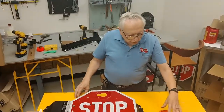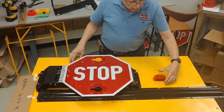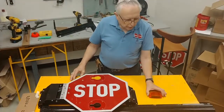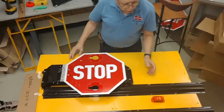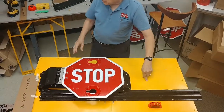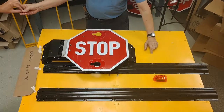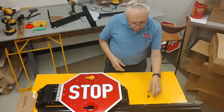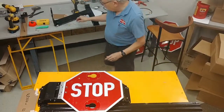The first thing you need to do is move this marker light. We aren't moving it anything that will deter from meeting the regulations — it's going to go from here down to here, and there's plenty of wire inside the bus area. You re-drill a hole here and plug the original one. We have a plug we'll send you, which is a five-eighths inch hole plug — it'll match up exactly to what's required.